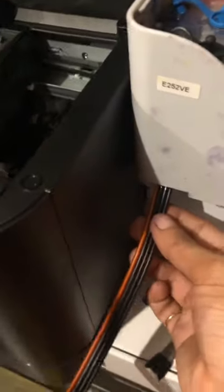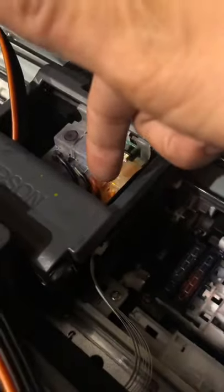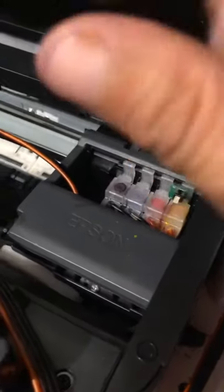However, what it was, was the pressure in the lines overspilling the ink that I had filled in the back. If you check these lines, make sure they're pressed, make sure there's no kink. And if it's good, then you move on to something over here. These were also pulled from when I had this too tight and didn't give it slack. When it came this way, it pulled the cords tighter, allowing this to be kinked on the inside as well. Check that out, guys.